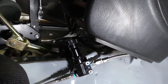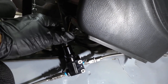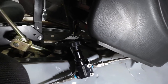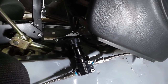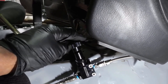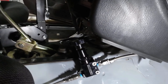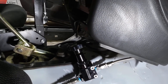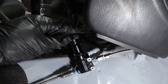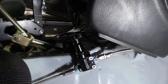Why would we need to adjust brake bias? This particular style is a knob-type - you turn the knob to adjust how much brake pressure goes to the rear. In normal circumstances you usually want more braking effort on the front wheels. However, some drivers adjust to compensate for fuel load, or they like more equal braking pressure on the dirt rather than front bias. Some people like more rear bias so that when they get on the brakes it starts to lock the rears first, which can help to turn the car in and slide around some corners.